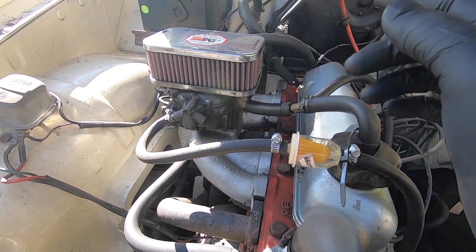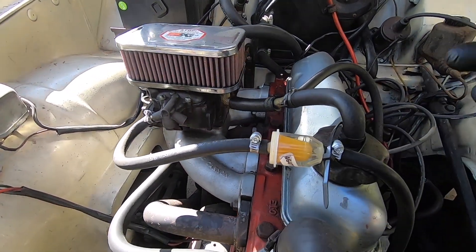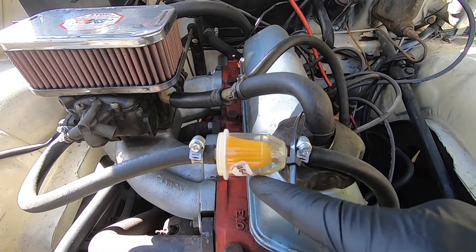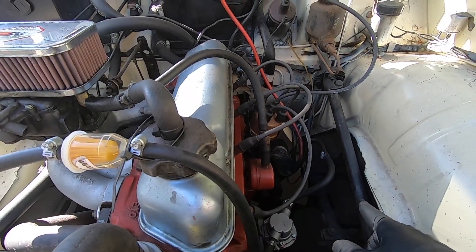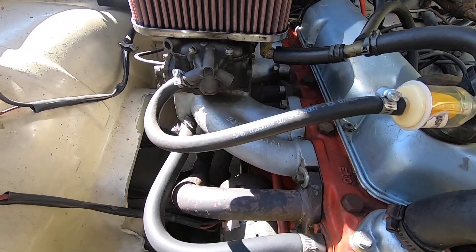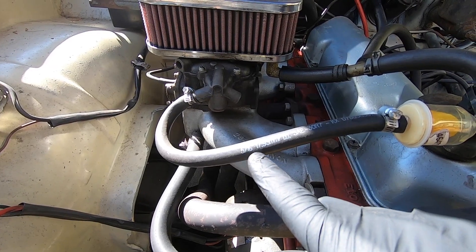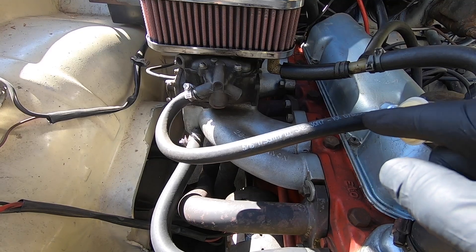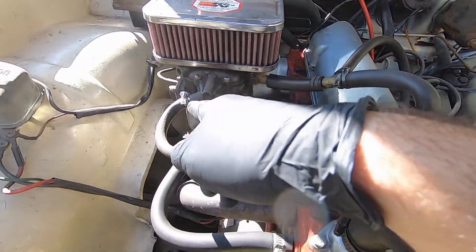By the physics of it, there's an air leak somewhere in the fuel lines. If you look at it, my fuel filter right now is empty — the whole line is probably empty all the way back. One thing that's been staring me in the face all along, and I never thought to check the spec, is that this is a 7.93 millimeter 5/16 fuel line going from the mechanical fuel pump to the carburetor.